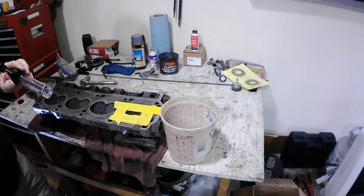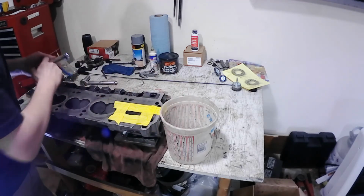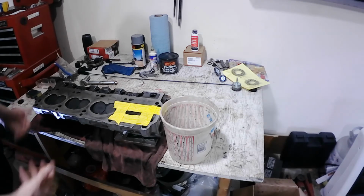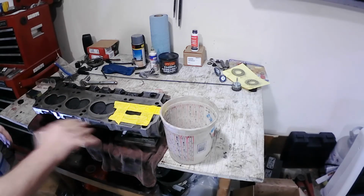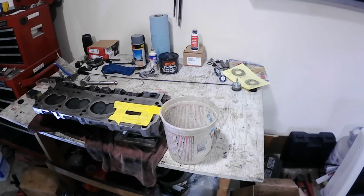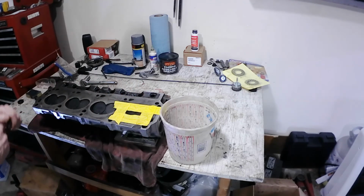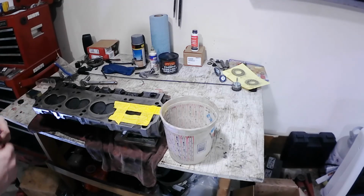Given I come up with 64, that number makes sense, and that's what we're shooting for when we do things like this. Is the result that I come up with, does it even make sense? So, yes, it does. So, that's a good check. It's roughly 64, I'd say 62 to 64 in there. I might add a little bit more because my tape isn't exactly flat right now. And you could use a piece of plexiglass in there, and that would get a little better. So there's good techniques, but this is good for what I'm trying to do, is get within that plus or minus 2 cc range. So I feel pretty good about my result.